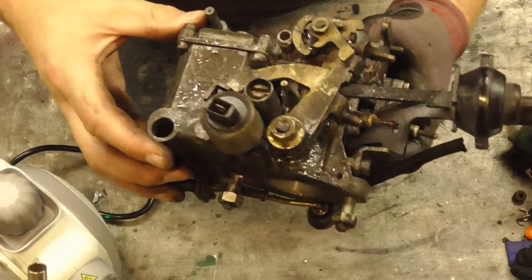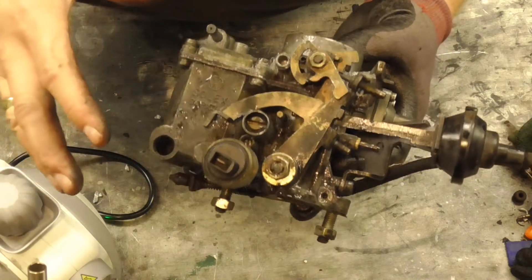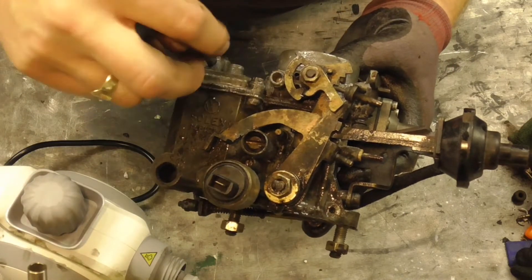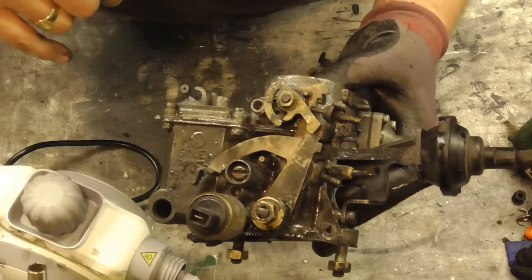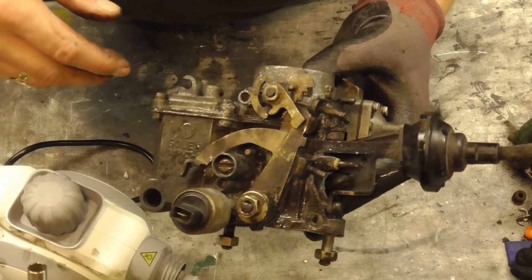It kind of just moves the oil around a lot, so I'm going to get the degreaser on it now and degrease it with a brush as I normally would. What the steam does do, as I've noticed, is it gets right into nooks and crannies — really awkward places which even with a toothbrush are pretty tricky. It's blasted out all that yuck, so it hasn't cleaned it off as such, but it's helped move it somewhere where you can clean it.